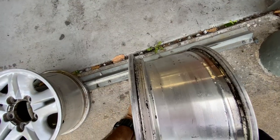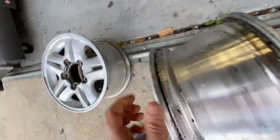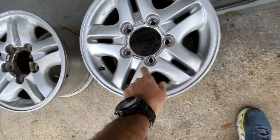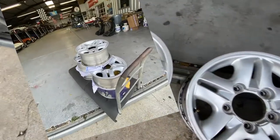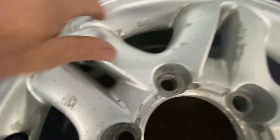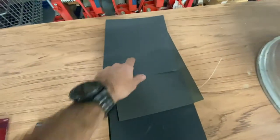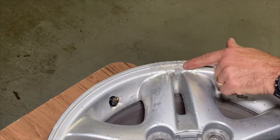From the back side, it's reasonably clean, but I'm not going to worry about that — nobody ever sees that side anyway. The openings on these rims are so small that once you put the tire on, you don't see the color of the interior anyway, so that's going to be plenty. We're going to do the other four rims and attack this spare wheel first. Most importantly, we have a heavy-duty pad, then a less aggressive one, and then various sandpaper: 400, 600, and 1500 grit for the very fine finish, which we'll use wet.